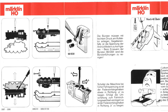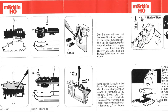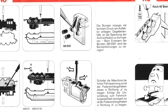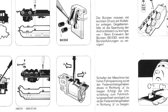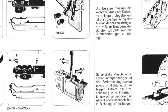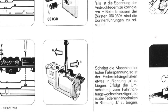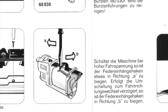The adjustment procedure is simple. Using a flathead screwdriver, the spring arm on the lever needs to be bent sideways — closer to the switch if the tension needs increasing, or away from the switch if the tension needs reducing. When to do what depends on the symptom, but appearances can be deceiving, and this is what my gripe with most how-to videos on the topic is about.